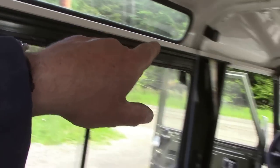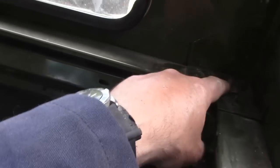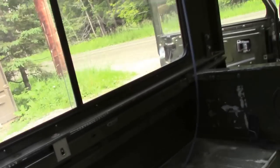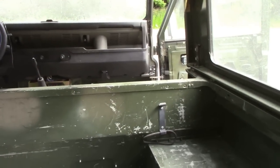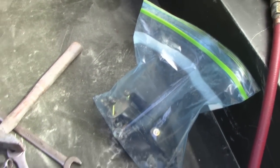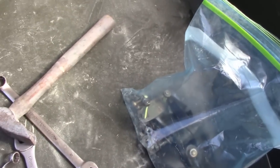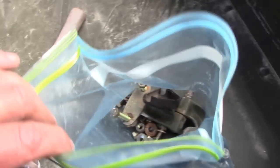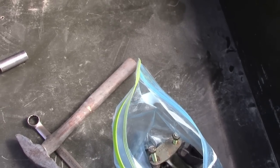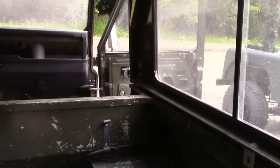It's quarter past nine now and everything's going well. I've got all the bolts out at the top and bottom, taken off the top pins and top nuts. I've left that little bracket on — look at this, it's just moving with one hand. The next thing is we've got to put the forklift on just to help us. A good tip: whenever you're taking things apart, just throw them in a plastic bag and try to put the nuts and bolts together wherever possible, like I did on this door hinge — put the bolts together and you know where they go back. So, get the forklift out, support this roof, and let's get those panels out so we can start cutting.